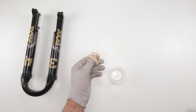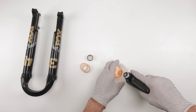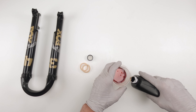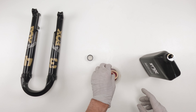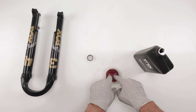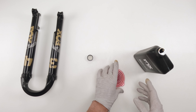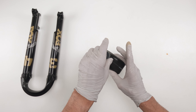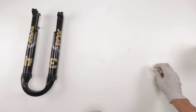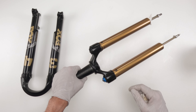Next, what we are going to do is take our foam rings from our 50 hour seal kit, put oil in a small cup — this is 20 weight — dunk them in there and cover it. Let them soak and put them on the side. Make sure you put the cap back on your oil so it doesn't spill. Now we are going to move on to the air spring service.